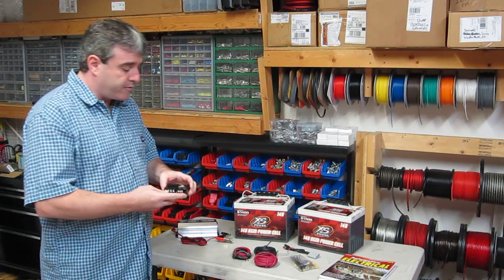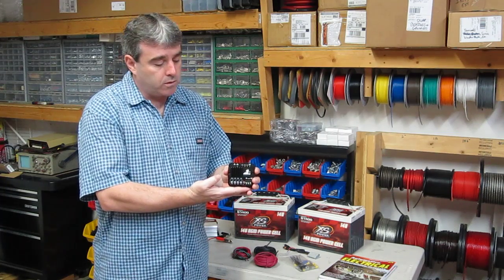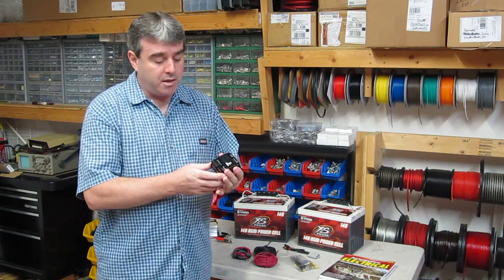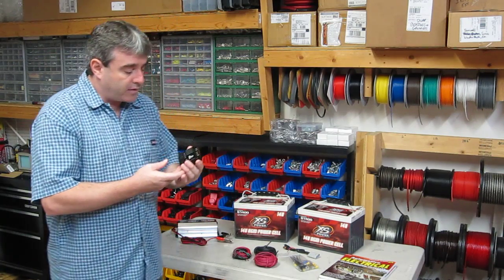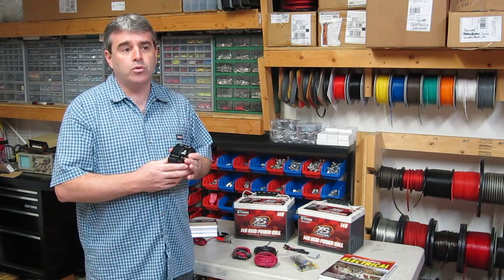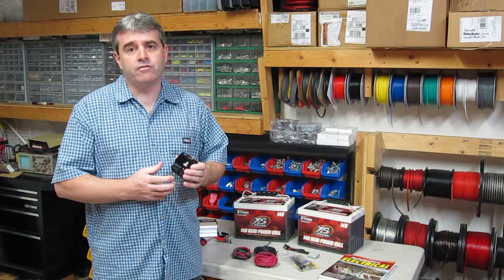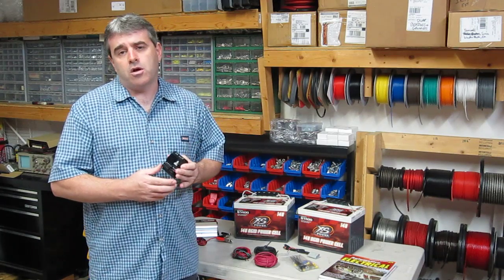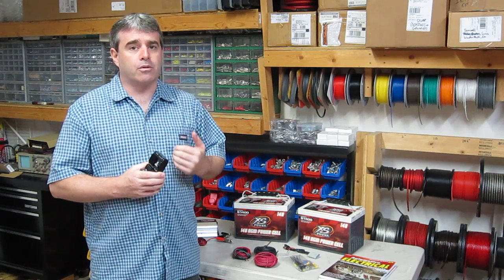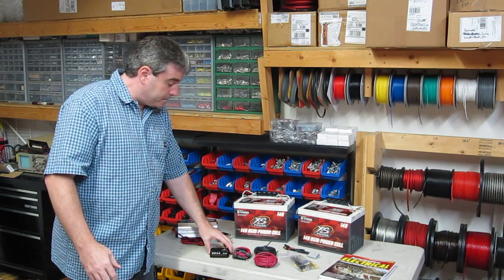There is a very clever device on the market that works hand in hand with this project to solve that problem. The device I'm speaking of is the Aeromotive FPSC — their fuel pump speed controller. Notice this is not like a pair of 30-amp relays; it looks nothing like that because this is a solid state device. What this device does is utilize pulse width modulation to regulate the amount of current that flows to the fuel pump without reducing its voltage. The net result is that we can actually slow down the fuel pump to bring our operating pressure back in line.